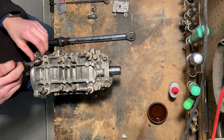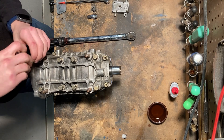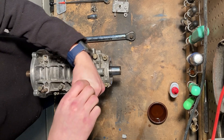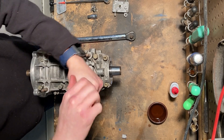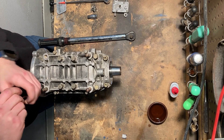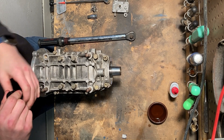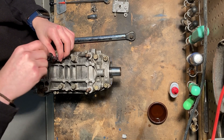While it's setting, I'm going to hone out the cylinder. I do not recommend using a bar hone on cylinders, because unless you are trying to remove a lot of material, a bar hone will pivot. It has pivots on the stones that help it take the shape and size of any cylinder it's honing. But that also means it can make a cylinder that's a little bit oblong even more oblong. So I'd recommend a ball hone just to try to mitigate that as best we can. I'm going to get these tightened down and then we'll see you again in a couple hours.